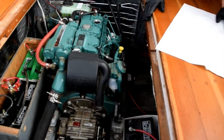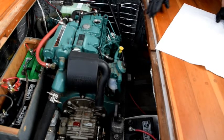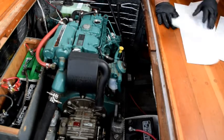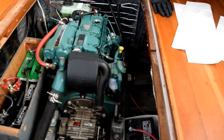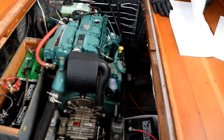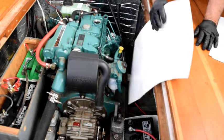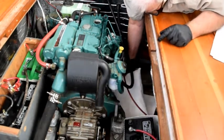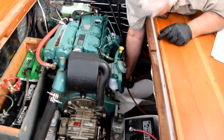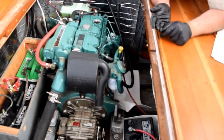So I've already put the dipstick back in. At this point I'm ready to remove the oil filter. Now, as is the case with many engines, the oil filter is mounted horizontally — it screws in horizontally. And when you take it off, it is going to leak some oil out. So I'm going to put an oil sorbent cloth underneath the oil filter to catch anything that leaks out, so that hopefully it won't end up with a bunch of oil in the bilge.